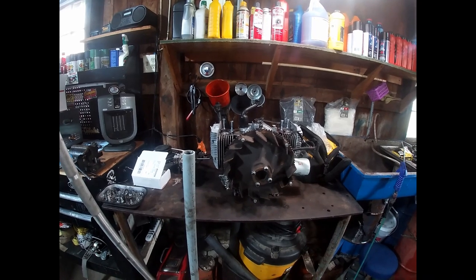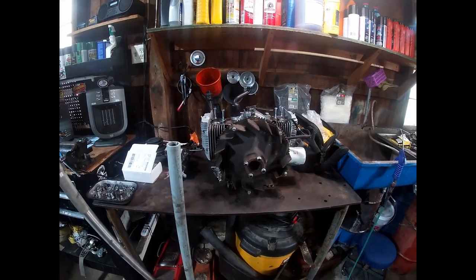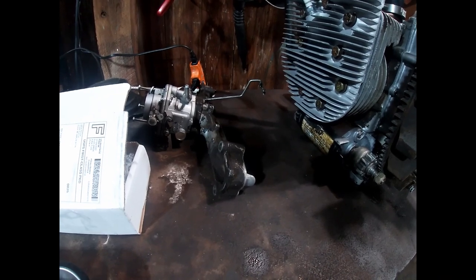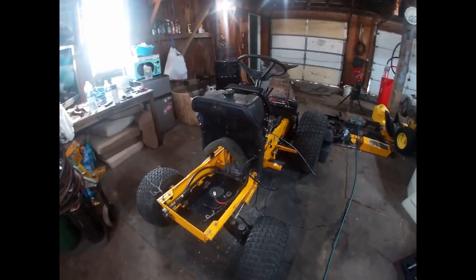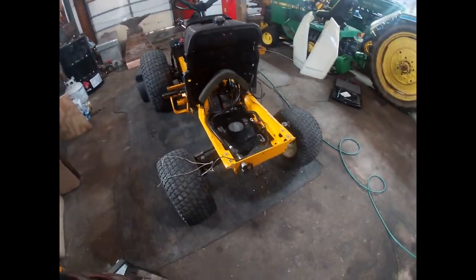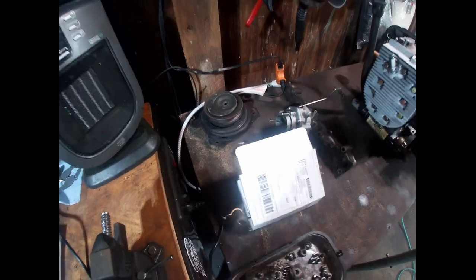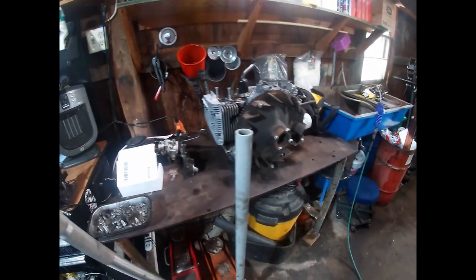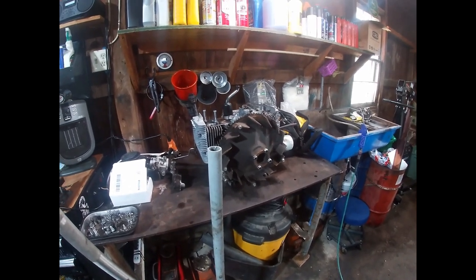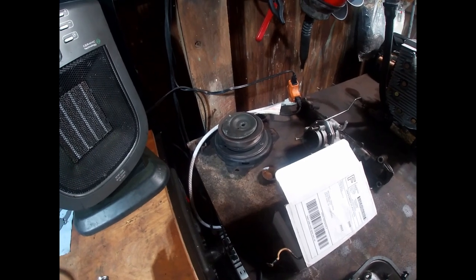I'm currently at a standstill while waiting for parts, because both of my Snap-on torque wrenches are broken — go figure. I have to send them out to get rebuilt, so I need to borrow a torque wrench to do the final torquing on the heads and manifolds. With these Onan engines you want to make sure everything is torqued to spec — especially the intake manifolds with the way they seal — because everybody knows how much of a pain those surging Onans are when you have an intake leak. I'm also waiting for a new field coil for the PTO clutch, because the original windings were pretty much shot. One of the three studs for the adjusting lock nuts had broken off and someone drilled a hole through the backing plate and put a bolt in with the wrong size nut. The armature is okay, just the field coil was shot, so I ordered a new one.